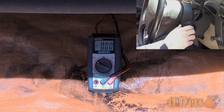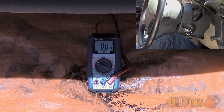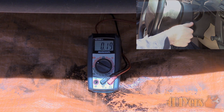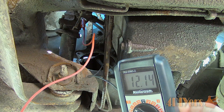Test the voltage at the solenoid switching wire — two people may be needed for this, or set up a camera and watch the multimeter as you turn the key. Battery voltage should be present at the connection. If not, there could be a fault with the wire or a faulty ignition switch if previous areas have passed. Now test the main power cable feeding the starter assembly. This is the high amperage side and should have battery voltage present at all times. If not, then there is a fault with the power cable.